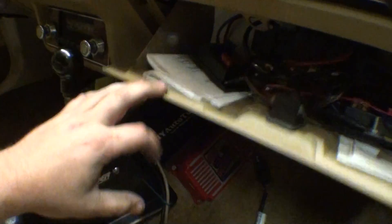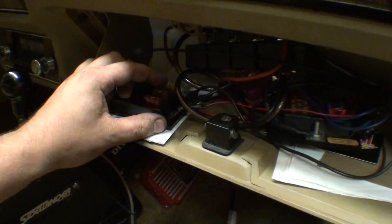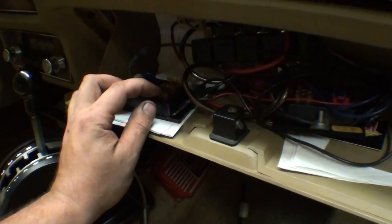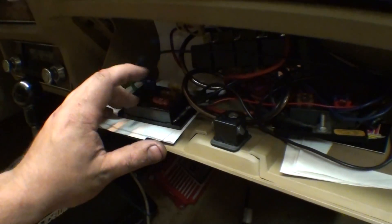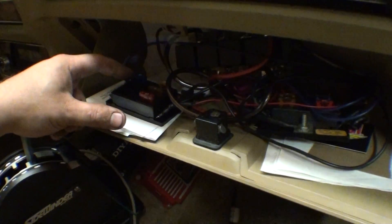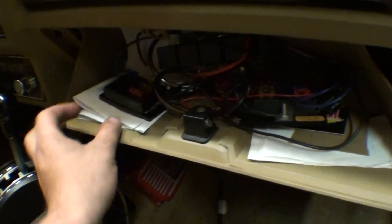Off the fuse panel also — you would do injectors 5 or 10 amps, injectors 5 or 10 amps, and about 2 or 2.5 amps for the Megasquirt box and the MSD box. You might even have two extras for your wideband and something else — that's why I ran so many. I have boost controller and all that in here too.